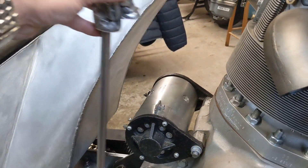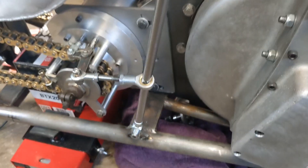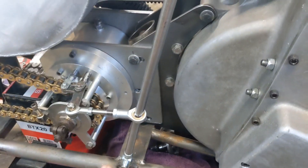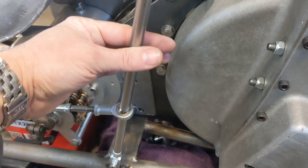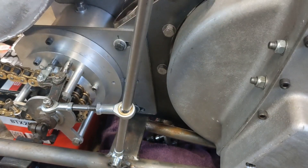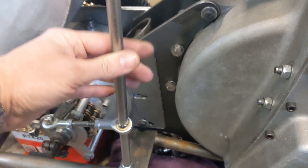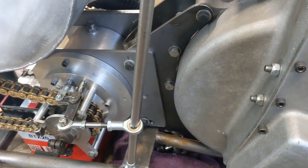I'm pleased with that — at this point I've got what appears to be a working hand change. There needs to be some kind of gate here because there's a lot of play in everything; none of this is particularly tight and it's only tack-welded on the bottom. So I need to weld it nice and firm, and then perhaps come off here with a gate that the stick moves through just to stop it moving side to side and take some of the slap out of it.